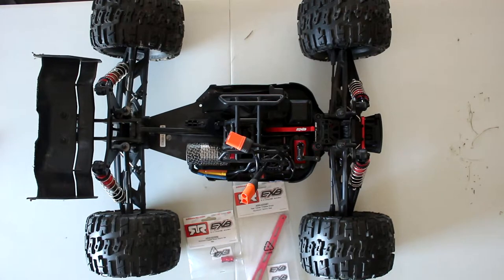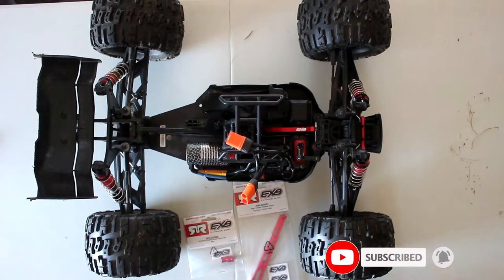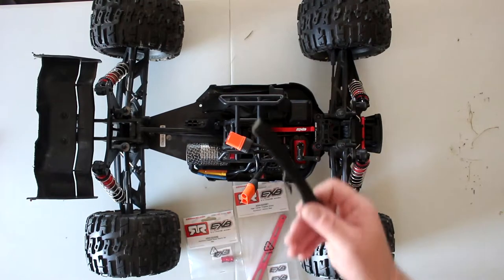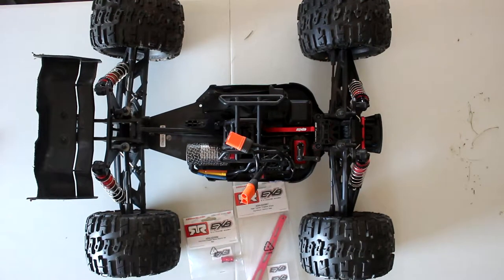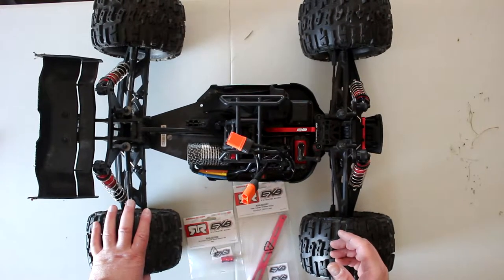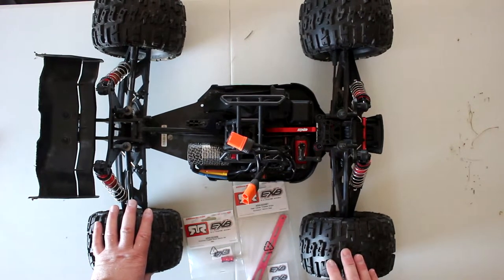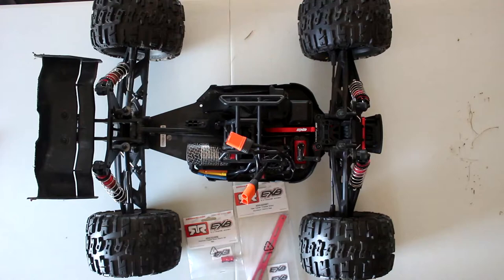The v1 and v2 don't have these pieces on. I just decided to add them to mine for a little bit more reinforcement, because the plastic — if I grab the front run right here — they're still flexible, there's flex to them. The aluminum has no flex. Now, going aluminum could be good or bad. If I do jump my vehicle and tweak that aluminum brace, it stays bent. There are ways to bring them back, but you're never going to bring them back perfectly straight.